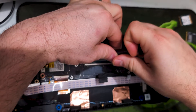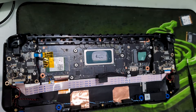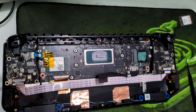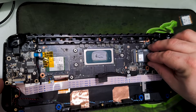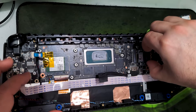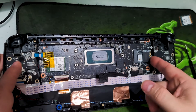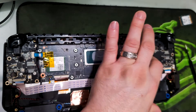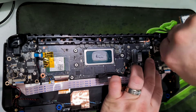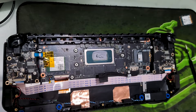I've got some new thermal paste — I'm just going to put a little bit here, not much, just a little dab like that. Now we can put everything back together. I put the thermal pad here — it'll heat up and spread out so it doesn't have to look perfect. We'll slide our new SSD in, make sure it is slid all the way in place and seated properly. There we go — you can tell if it's seated properly if it lines up with the screw hole. It does, so we'll screw it down. There's our new SSD in place.